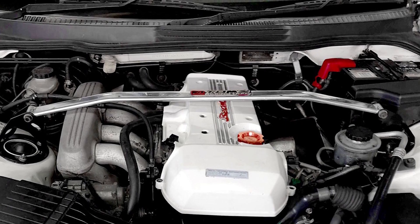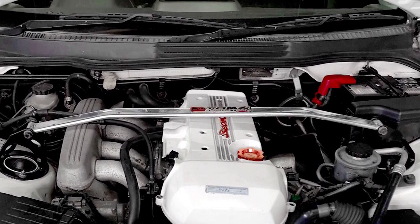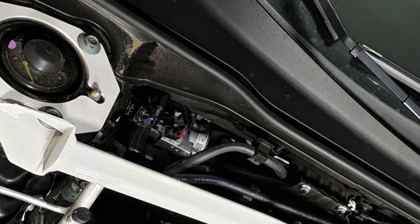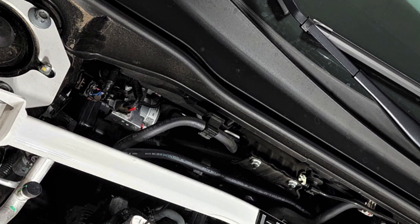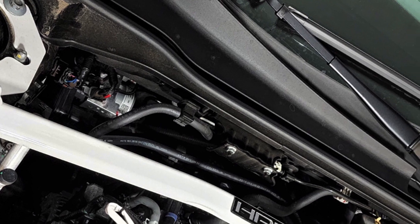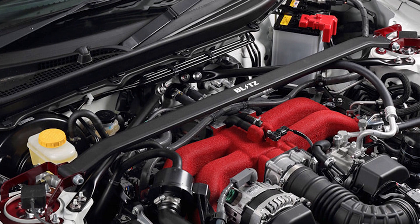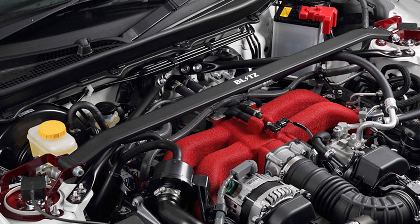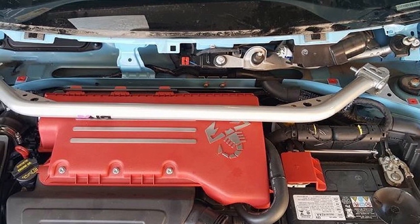Drivers will feel a rigid body the most over choppy pavement, where the chassis is taking impacts and flexing constantly. Cars are always twisting and deforming as they respond to road surfaces, and that deformation is carefully understood by the engineers of the vehicle. Like anything in engineering, it's a compromise versus cost. Think of the body of the car as its own spring, or a guitar string — impacts and cornering twist it out of shape, and it has to spring back into its normal shape.